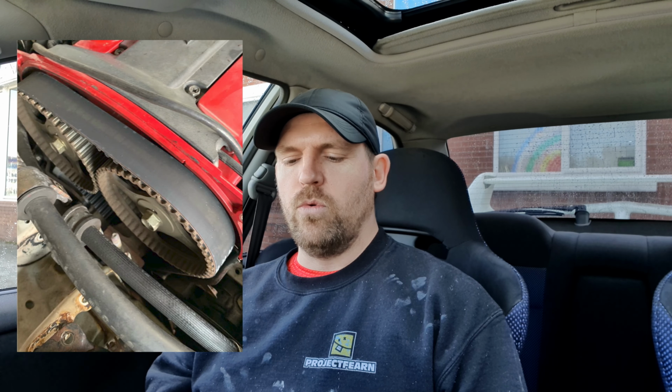So after Rob had it, it then went over to Dan at AMD Limited, who's absolutely ram busy at the moment, which is a good thing for him. So while it was there, the first job that he did was the timing belt and the water pump. This is the first job on my list, should I say. He did do it in a different order, but the first job he did was the timing belt and water pump. He's also done a rocker cover gasket because it just started to leak slightly.